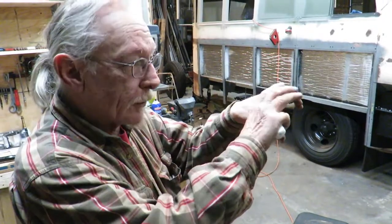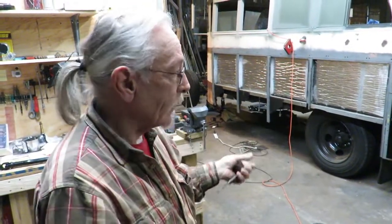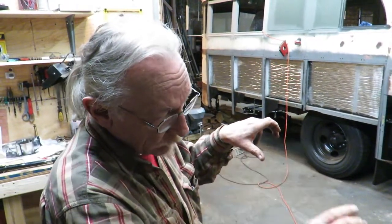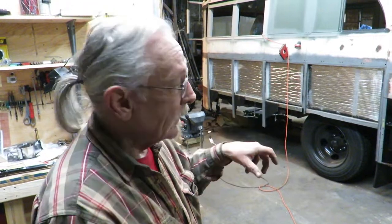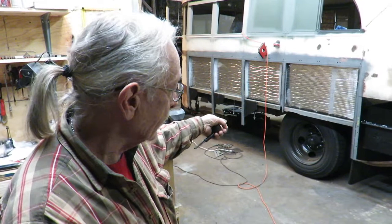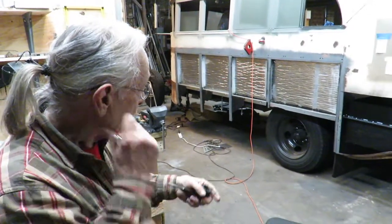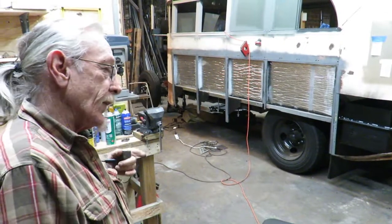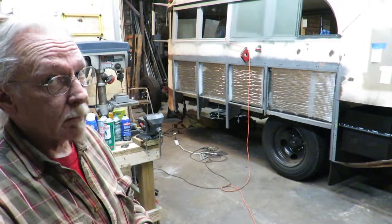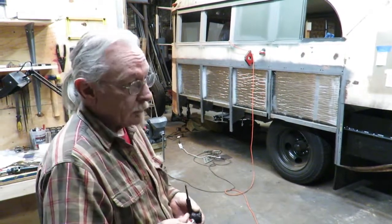The old one came off the turbo in an immediate, real tight 90 and down in another 90. Pretty typical because of the room that I've got there now. It comes back, goes down at 45, another 45, and then I've got the rest of the components to bring it out right in front of the driver's side rear tire. But I had to route it up and over the drive shaft, which is another thing I have yet to fabricate. It'll have to be built from scratch, like everything else.